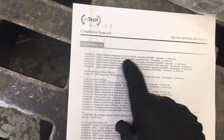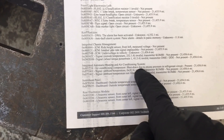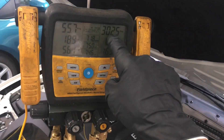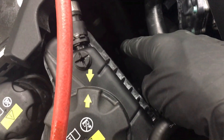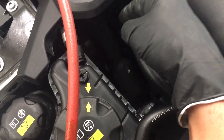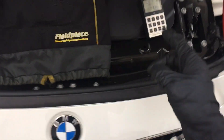They had an invalid reading — I'm not sure on the BMWs — but this was before repairs. Their AC diagnostic code was: air conditioning system shut down due to excessive pressure. Now that we know we have a liquid plate heat exchanger down here that has an expansion valve on it and a receiver dryer all in one big module, you have to get coolant flow from one of these tanks. They also had to drain and refill one of these tanks from that accident because they had to take everything apart.